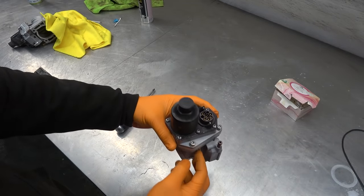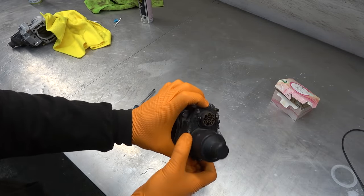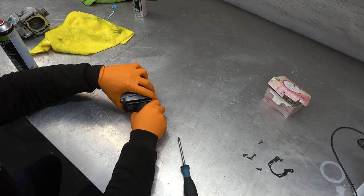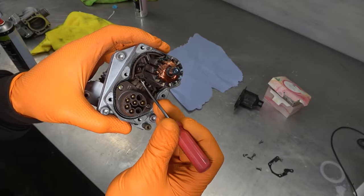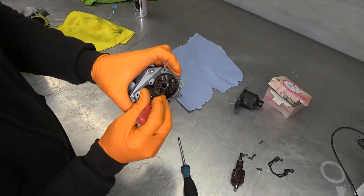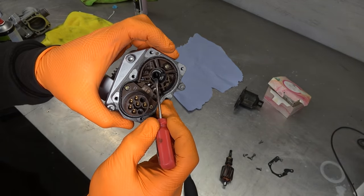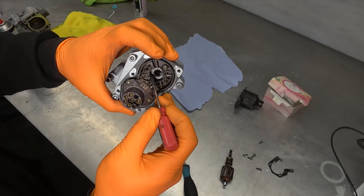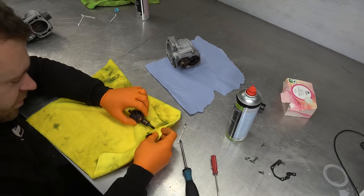This is the early M70 throttle body which has normal screws so you can open it easily. The later ones have anti-tamper screws which can be a pain to remove. There's a strong magnet inside so you have to pull it out firmly. Now it is a bit dirty — this is the commutator we need to clean. I'm going to pull the brushes back — some seem stuck. That's what we need to clean. Look at the brushes, see how they should move much easier than this. This is just looking really dirty — it's going to benefit so much from cleaning.